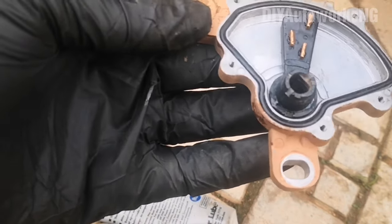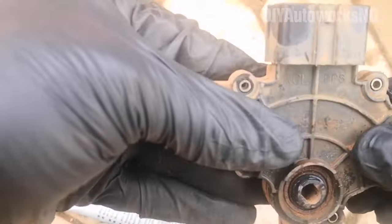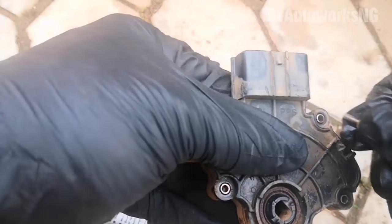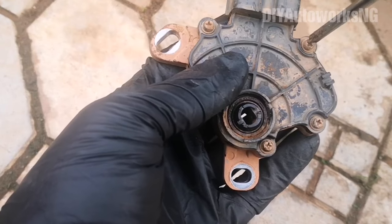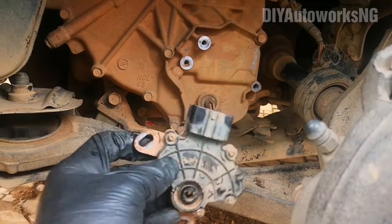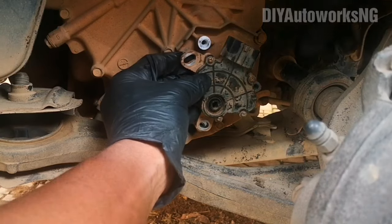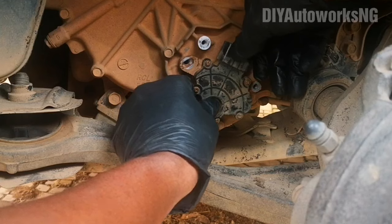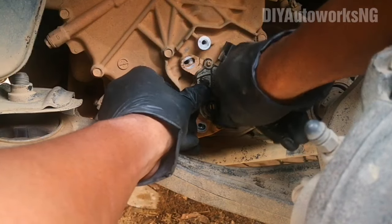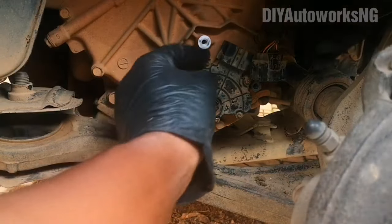Make sure the O-ring is well in place — it is. This goes back, gives a nice seal, and the screws go back in. Final screw in. From here it's the reverse procedure. Ensure that you don't move the position of the gear stick, as I said before. Just realign this and push it all the way back. It fits well and laps quite well. You have to put back the connector before you tighten it in.